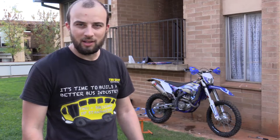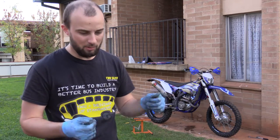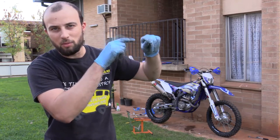The little tricks I use: I inflate the tube a little bit so that it doesn't get pinch flats as easy. And as I'm putting the last bead on, I always look under to see whether the lever's got the tube or not. I've had pretty good success doing it that way.